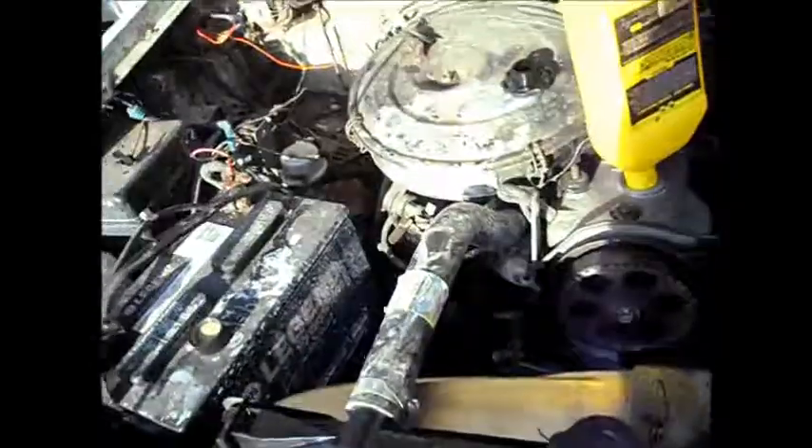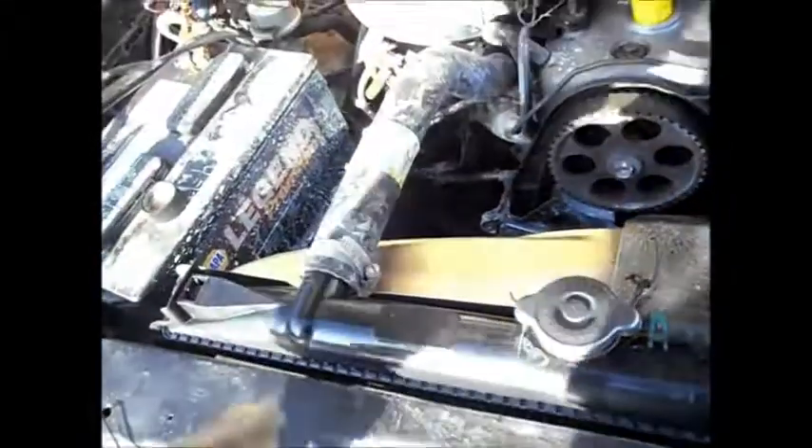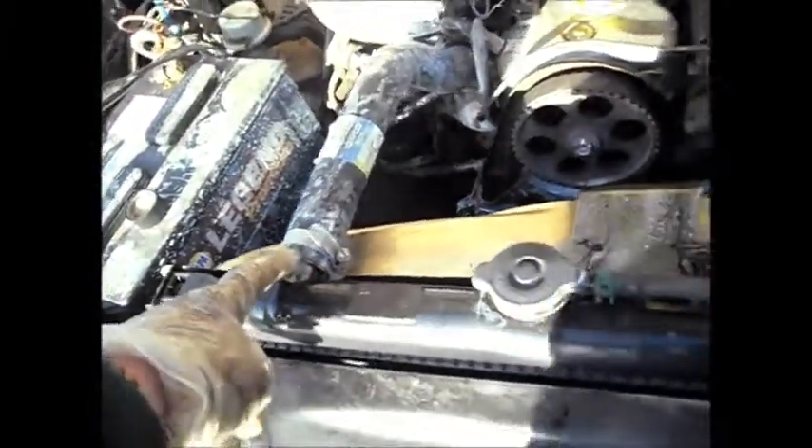Another day hard at it. I wanted to give you a tip about the hoses — make sure that the hoses are tight and that you have a good radiator cap. Because these systems work under pressure. Basically, if you have a leak, it sucks cold air and it makes it overheat. So you want to make sure all your connections are tight, top and bottom.